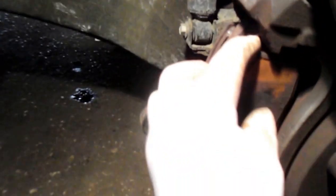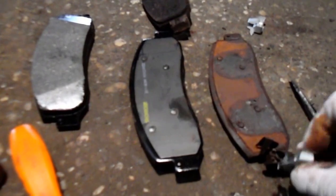Take your two brake pads and put them on the ground for now. Take the old pads out. Whenever you change brake pads, you have to put on the new hardware that comes with them. Lay the pads on the ground and put your hardware on the same way it comes off — there's really only one way it can go.